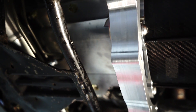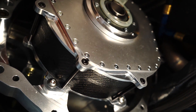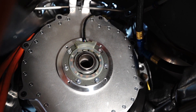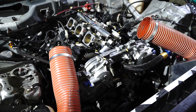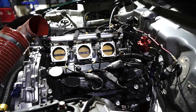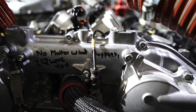Here you're looking at the motor directly attached to an adapter plate that we made, bolted to the engine. This adapter plate is basically a spacer between the engine and the bell housing of the transmission. There's a shaft directly connecting the crankshaft of the engine to the shaft of this motor, so whenever the motor is spinning the engine is spinning, and vice versa. This means even in full EV mode the gas engine will still be spinning and making gas engine sounds — which is kind of cool. It also means that if something catastrophic happens anywhere in the drivetrain, unfortunately the vehicle has to come to a complete stop.